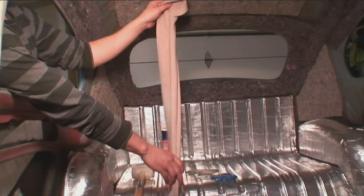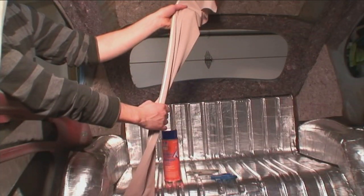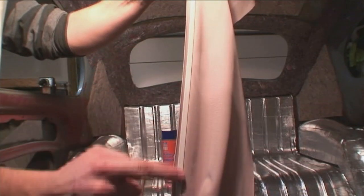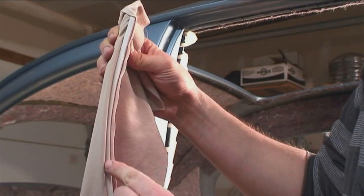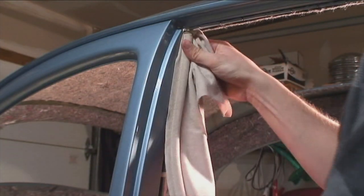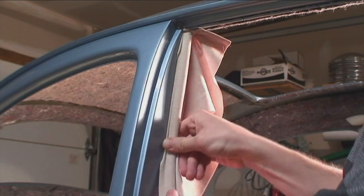Here's your wind lace, and basically this plastic white strip is going to be going into the grippers. This is the first thing that gets in. Usually those wind lace, it doesn't matter which side it goes on. You're going to want to pop that into the teeth there. Just tuck it in by hand at first and get it all set up. Take your time.